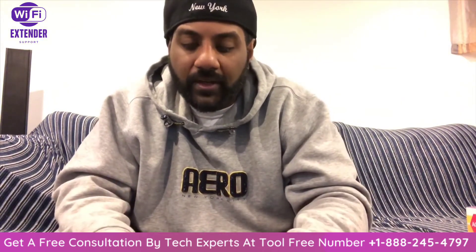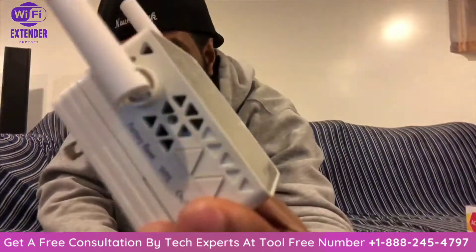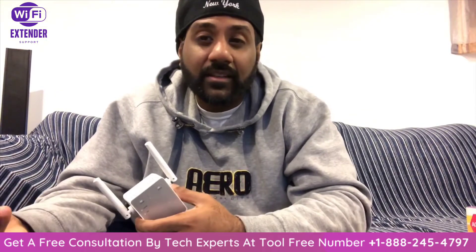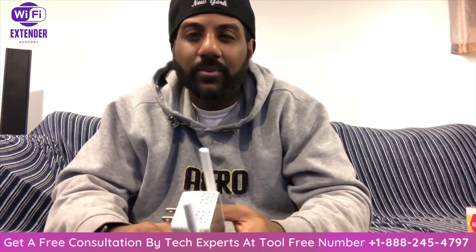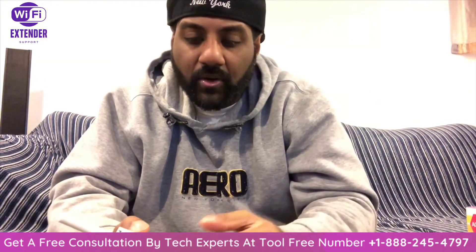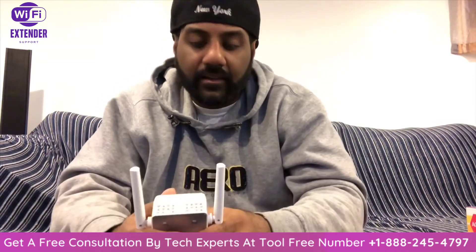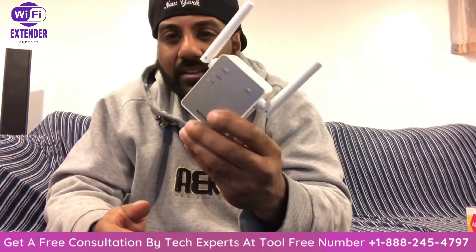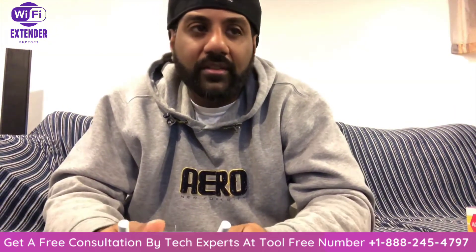The steps to connect this — it's easy. You can either do it through the WPS button right here: hit this, then hit the one on your router. Some routers don't have a WPS button, so you go through the router settings by logging in through your IP address — usually admin and admin for the password, or it's on the back of the router. You log in, turn WPS on, and that makes it discoverable. Hit the button and it should connect fine. You'll see it show up as 'Netgear_EXT' and then you can rename it and add a password.